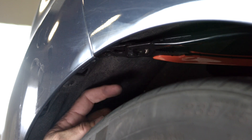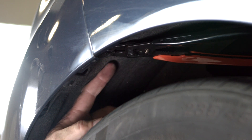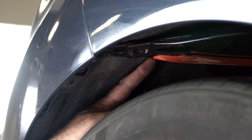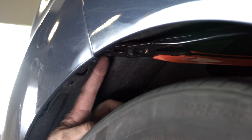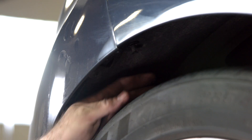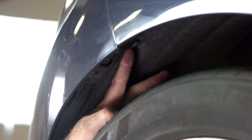We're struggling a little bit with this fastener above the tire on the passenger side. They can become loose over time, so basically what we're going to do is create a wedge. I used some crimper strippers here and wedged it right behind the backing of the fastener, and now that should allow the center screw to come right out of it. We've got that screw loose, so I'm going to get the center piece out. The backing should just pull right out.